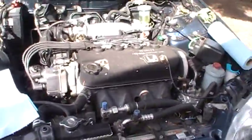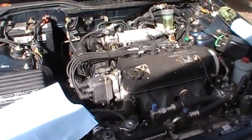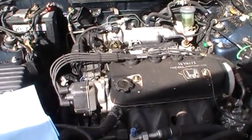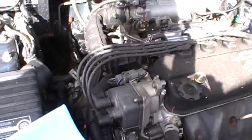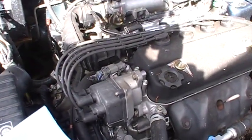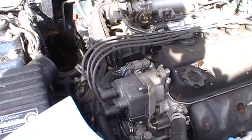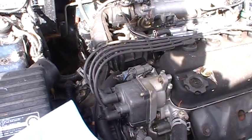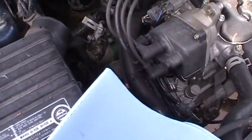Anyhow, so key to this is preparation. Hopefully I thought of everything. We'll just start right into it. Make sure you get your hydraulic fluid ready to go. You want to have a crush washer. They're kind of expensive at the Honda store. Just get an 18 millimeter aluminum crush washer. My dealer only charged me $1.80 or something like that, and they're usually like $3.